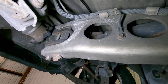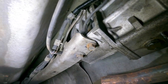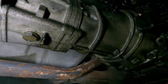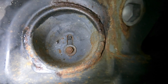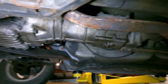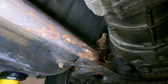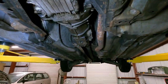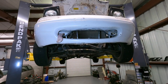We do not have a clutch yet, so I need the car to roll. This rear transmission mount is interesting — this brace runs all the way to the rear diff, but it looks like just two bolts. We'll get those unbolted, get this wiring harness out of the way, disconnect the speed sensor cable, and get the two side mounts unbolted. Most of the stuff up top is unhooked and I think we can pull it out with the engine hoist. It's going pretty smooth — only about 20 minutes in.